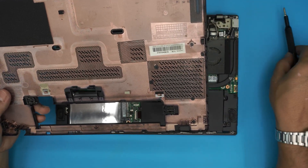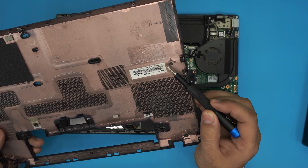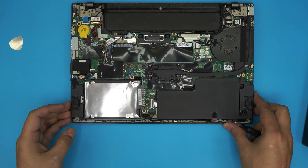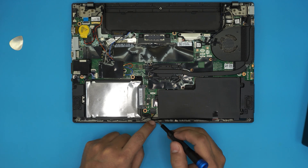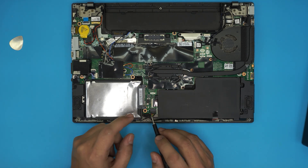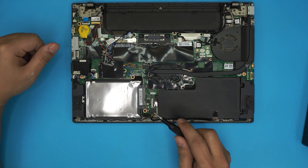That's the bottom cover and the C-locks are right under the screws that prevent them from coming out. Down here the internal battery is right here — if you want to disconnect it, just pull this jack backward and the battery will get disconnected. But you do not need to remove or disconnect the battery if you just want to upgrade the hard drive or the RAM.